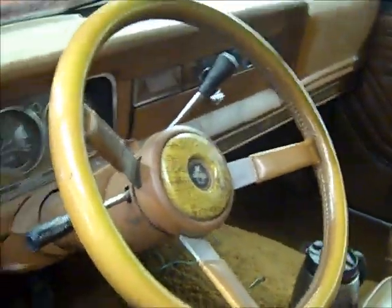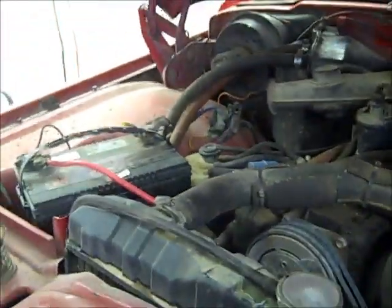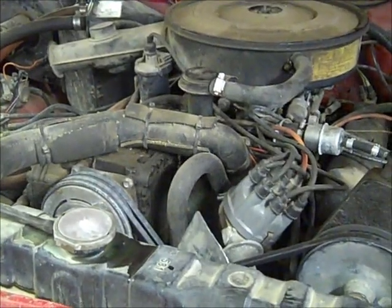We got it all put together. I've been fighting a couple little issues — I had it idling out in the driveway. I'm not getting any heat up to the heater and I'm kind of wondering if the water pump isn't bad as well. It's not showing anything on the temp gauge, but that doesn't necessarily mean anything. 255,000 mile Jeep — expect some things to not work. I also can't find the temperature sending unit. It doesn't seem to be getting too hot, just pressuring up pretty good, but that's fairly normal. I was getting a leak right off the bottom of the front of the crank, so I tightened up some clamps down in there.